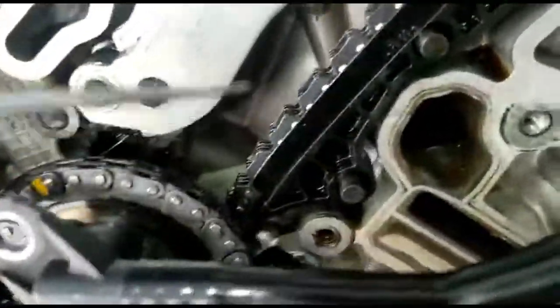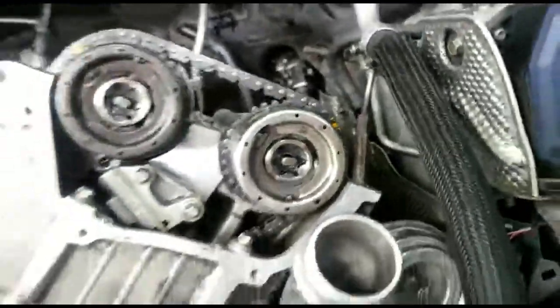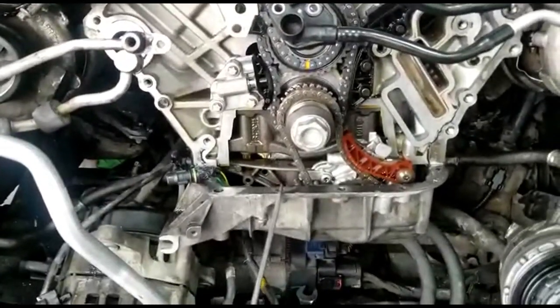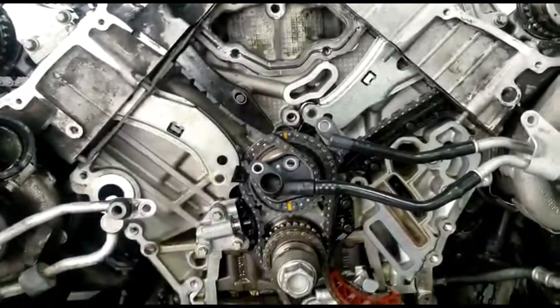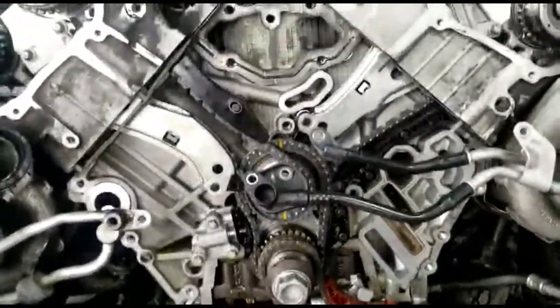This chain also goes to the pulley inside, which has a mark on the bottom - you cannot go wrong. To take the cover off, you have to loosen up the oil pan so the cover can come out and go back in. GL 63 AMG - some people don't like to do it that way, but I did it that way. It's easy for me to work. I put it together and hopefully tomorrow it will be finished.